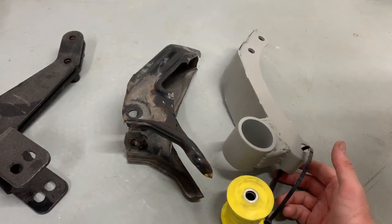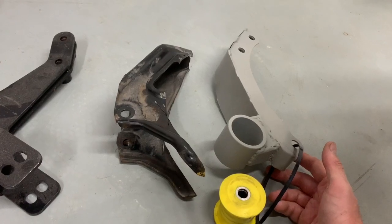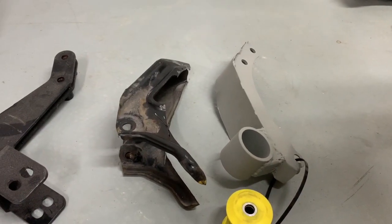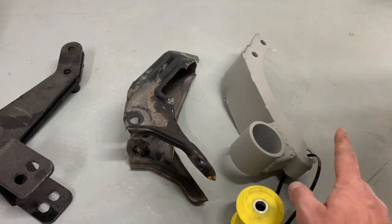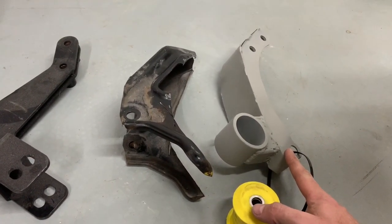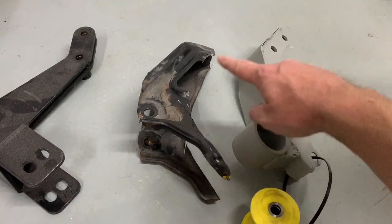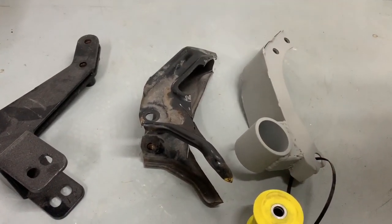This is the rear mount, which we've finished up with a little poly bush that goes in here, and then that will go into the rear subframe. This is basically a cannibalized OEM Honda mount — the EP3 mount — but it had all this extra material attached to it, so all I've basically done is cut it all out just to get the clearance for the rear subframe.